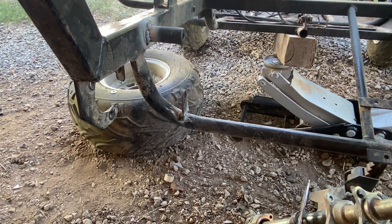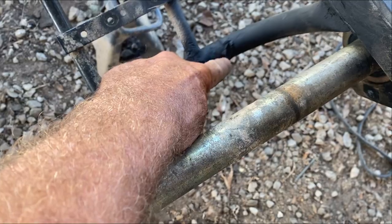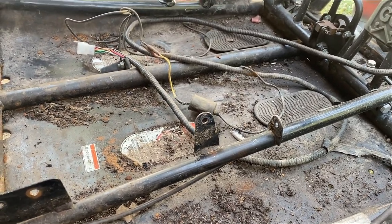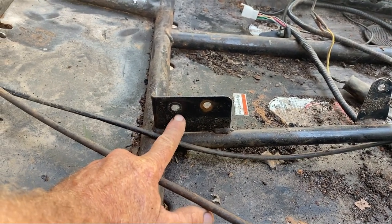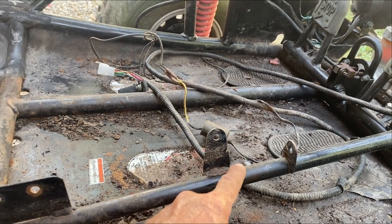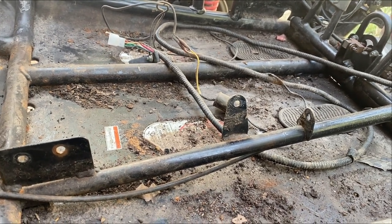I finished up my welding and cleaned it up - there it is stuck back together. But I just discovered something else: if you really don't want to cut that little bracket off because it's in a hard spot to cut, as I was removing more stuff like the parking brake mechanism, there is a good bracket right here that you could easily cut straight. I'm going to cut that off because I'm not going to have a parking brake and don't want any of this sitting up in here. Also this one was where the forward and reverse gear shield was. That bracket right there would have worked perfect - just cut it off, then take the cutting torch and cut a half circle so it sits down over that pipe. So you wouldn't have to cut that one off the back - these need to be cut off anyway.